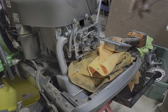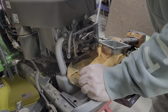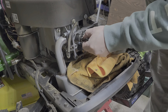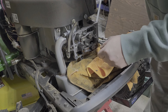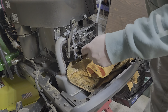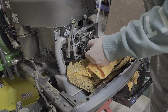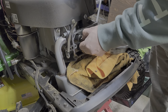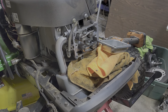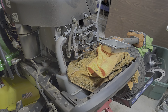I think somebody had this apart for whatever reason. We can roll this — I can kind of try to guess where we're at. We're at top dead center there; we can measure that out. The reason I know we're at top dead center is I saw a double detent with the cam detent in there. It's a four stroke, but I can just tell by looking — they're not terrible.